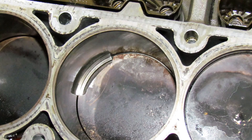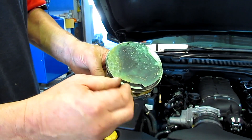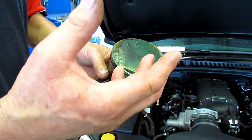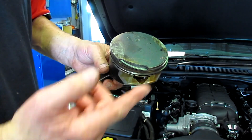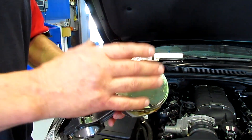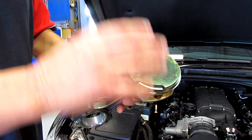And this is what happened — it broke a piece of piston out. No detonation or anything like that, it was running very nicely, but making too much power. Power in your cylinder, too much horsepower is heat, too much expansion on your top ring until the ring nips out, grabs, and then tears a piece of piston off. Not uncommon for high-power play with a standard engine if you're on that throttle for too long.